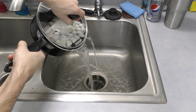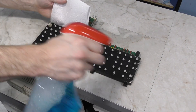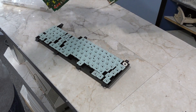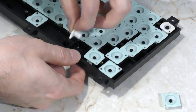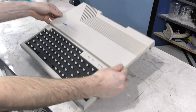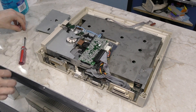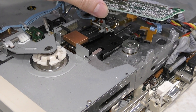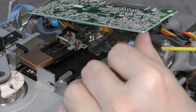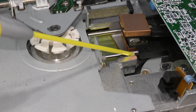It's been an hour, so time to drain out the keys. Before I put them back on, I want to clean this part of the keyboard. Now to take this keyboard apart so I can replace that one plastic part — this is the piece we need to replace, and I'll be replacing it with this one. The top piece is all reassembled and it's looking good. Before I put this back together, I decided I should do some maintenance on the floppy drive, even though it is working. I don't even need to remove the drive from the computer — I just need to get access to the rails. I need to put a small amount of fresh lithium grease on both of them and then move the head back and forth a few times. I'll also put some on the other sides here.